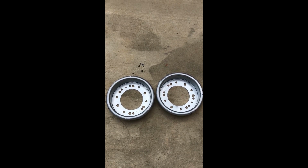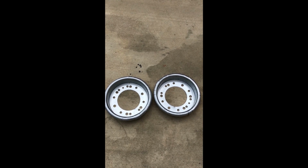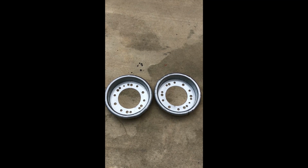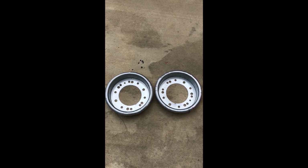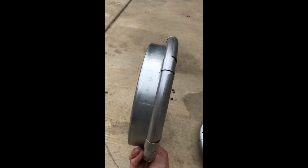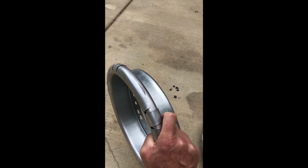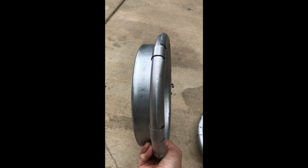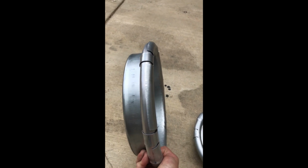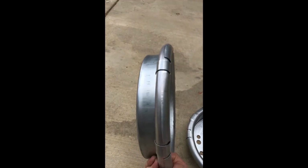They've got, looks like some universal, or maybe not universal, but hub stud bolt patterns that probably line up with several different types of studs, so they don't have to keep making different ones specific to every hub. So that's what they look like, front and back. And I don't know if you can hear it or not, but I can hear it and feel it. The small beads that do the balancing magic in these are rolling around this outer donut. Alright, so we'll get these mounted up.